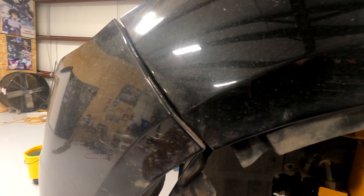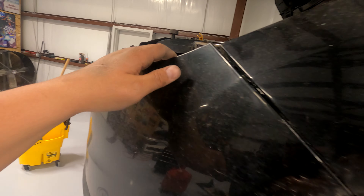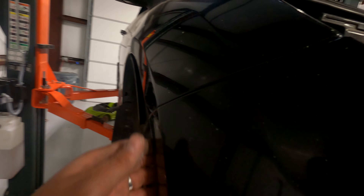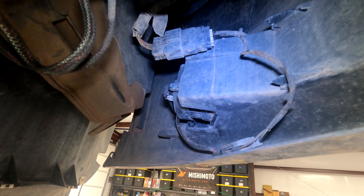My clips are different because I think mine got messed up, but whatever your clips are, just take them out. Now you just pull — mine's a little loose so it came right away, but you might have to tug a little bit. This little plastic piece should be locked in, so you're going to have to pull to unclip it from this little tab. Pull it loose on both sides. On the driver's side, unplug this harness which gives power to the fog lights.